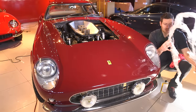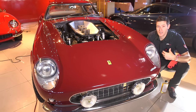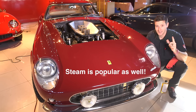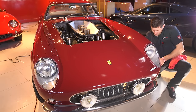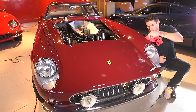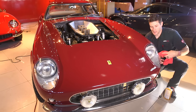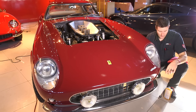The clear bra's off and it looks like this crazy monstrosity over here. Just take your time and slowly peel it off. Try to peel as close as you can to the paint and use adequate heat, but not too much. If the paint's going to go, the paint's going to go — that's another reason it's always a good idea to hire a professional. The last step is little spots of glue left over. My go-to is Goo Gone — open it up, pour a little onto a microfiber towel, dab that area, let it do its thing, and you can just pick up the residue with your nail.